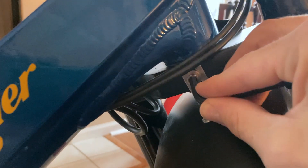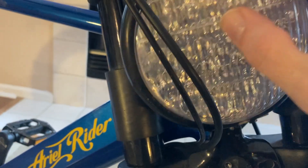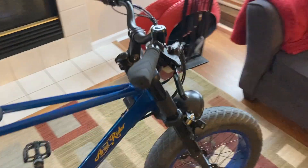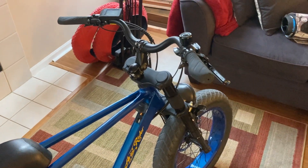So we're starting with the plastic fender, we're just going to go ahead and remove that. Don't buy one Allen key, buy the entire set of them. Fenders off, headlights off, we're going to do the handlebars now. So let's go ahead and get these off and then we'll see how to get that fork out of there.